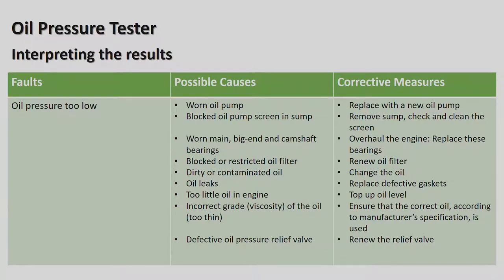Okay, now another thing that can cause the oil to get low in the engine is that the actual oil rings are damaged on the engine, and so it actually burns some of the oil while the engine is running. And so that can cause the engine oil to disappear. All right, you might have no leaks in the engine whatsoever, but it's actually burning some of the oil going past the oil rings and being burnt with the petrol air mixture.